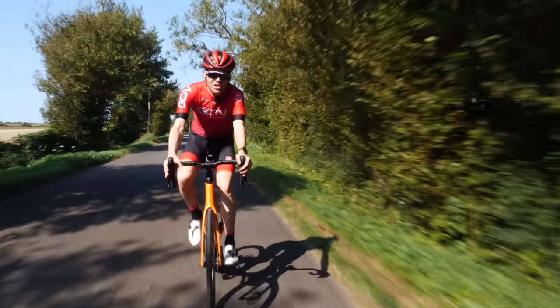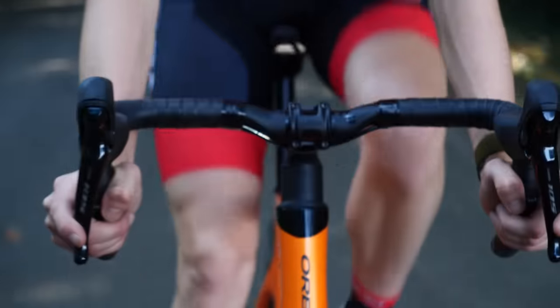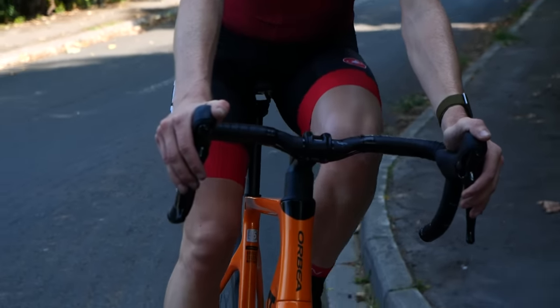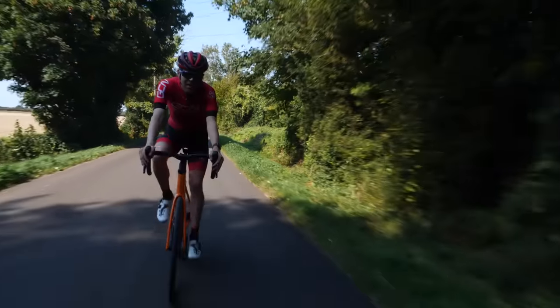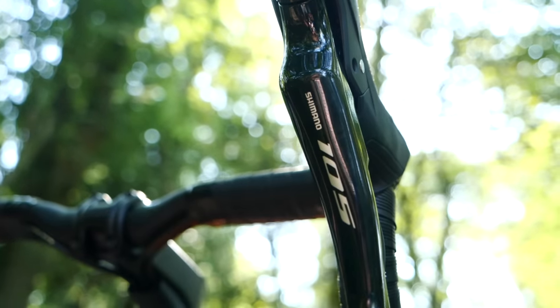The shifter hoods on this version of 105 are noticeably bigger and a little bit longer than that on the Dura-Ace. And this is because, as well as having the shifter mechanics in them, they also have to house hydraulics, because I'm running the hydraulic disc brake version. If you use the standard rim brake version, the shifters are actually smaller.